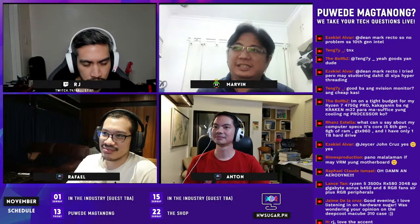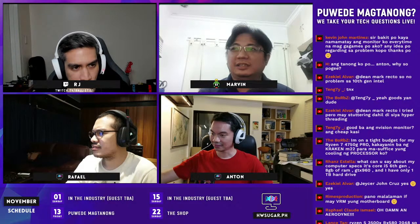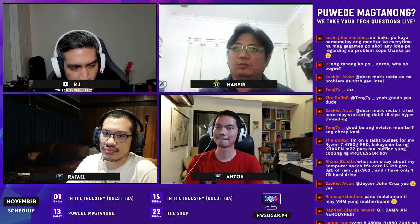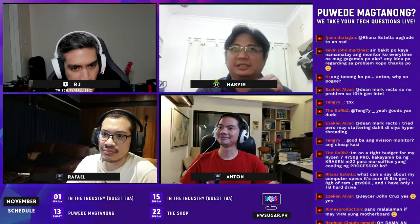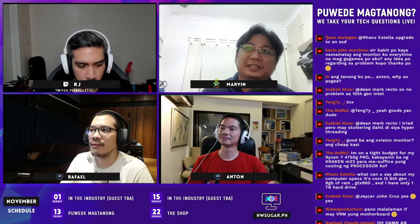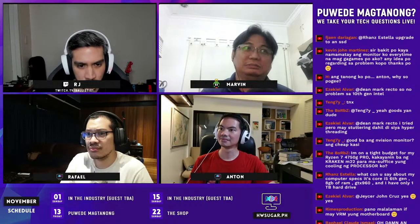I guess he has to distinguish if the internet connection is the one disconnecting, or if the computers are disconnecting from the network built by the router. That's a good point. Yeah. Sometimes that happens, one computer is not communicating with the network, but if you look, it's still alive on the internet. And also, if all of them. If all three get disconnected, then it can only be the router or the modem. If only one computer is disconnected, then it has to be the LAN cable.